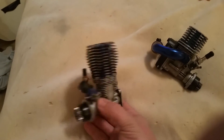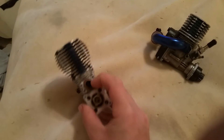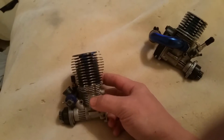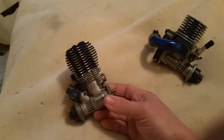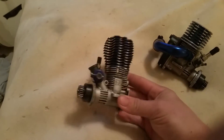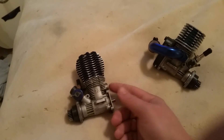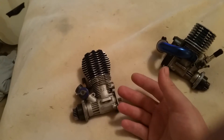Inside of the block and the piston sleeve, the block — also known as the crankcase — is going to have one hole for the exhaust usually, sometimes more, and then there are basically little channels grooved into the inside of the engine block that allow the air-fuel mixture to come up into the combustion chamber. These do not have valves. The way the air-fuel mixture gets into the combustion chamber is from an effect known as scavenging — the exhaust leaving the engine creates a vacuum that sucks the new air-fuel mixture in to combust it.